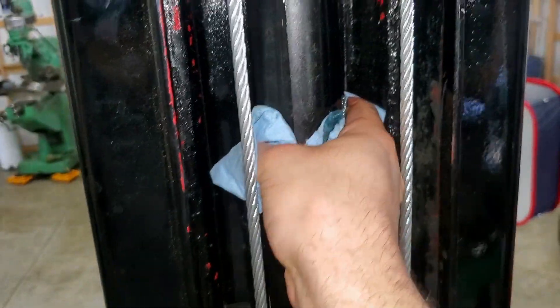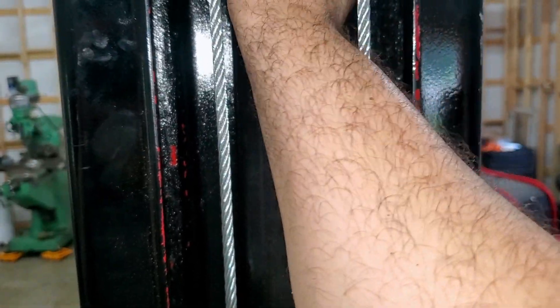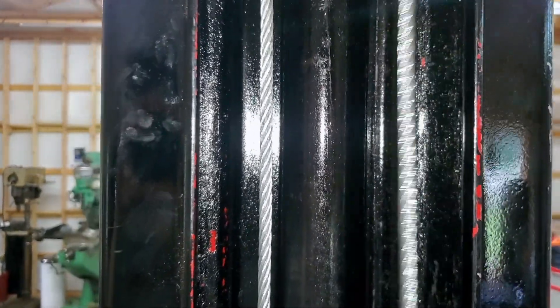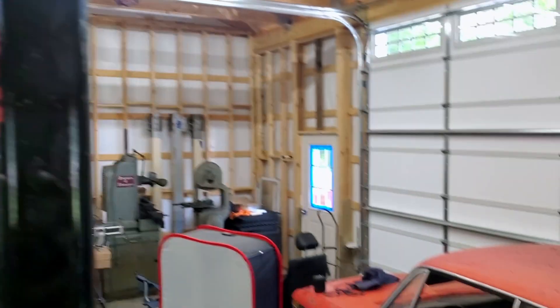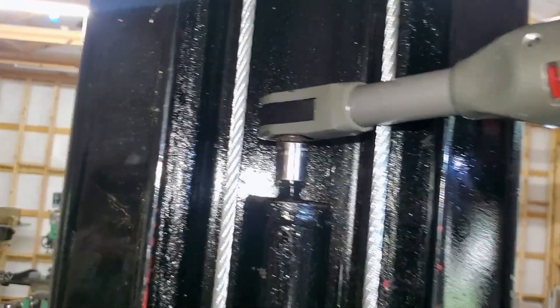That's just for demonstration purposes. If you see oil coming out at this rate, then it's probably bled — you'll know. You'll hear hissing if there is air in the cylinder. Speaking of lubricant, we will have to go ahead and oil up these cables with some cable oil. Let's get this tightened — that should be good, just needs to be snug.